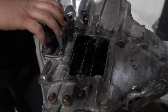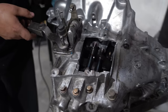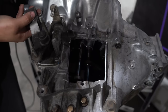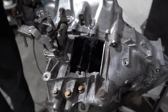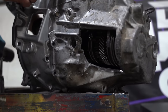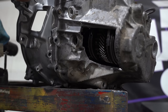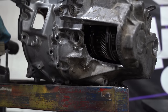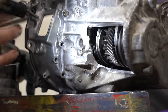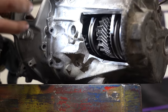Second. Now you gotta get the dogs open up. Second. Third, I'll take a seat down here. Oh, that's so cool. That's fourth gear. That's fifth gear. Obviously when it's in the neutral positions, free-floating, not near any of the gears.